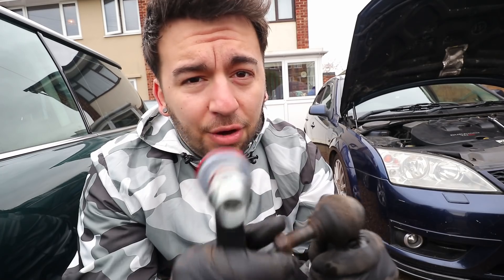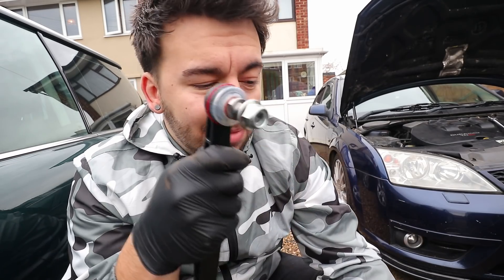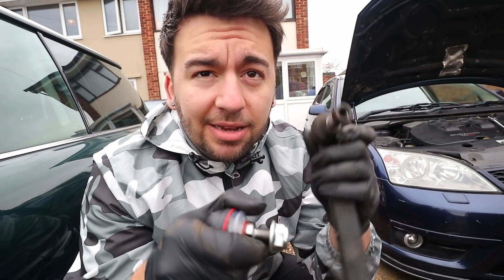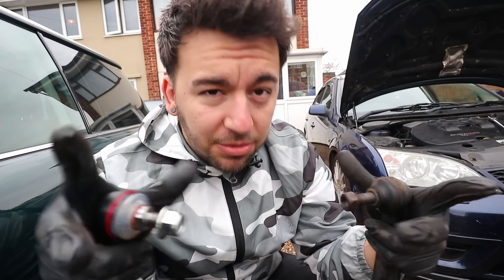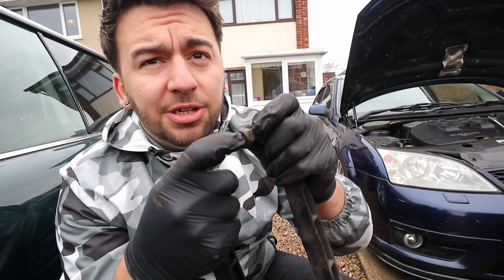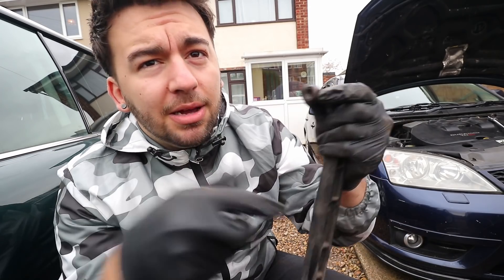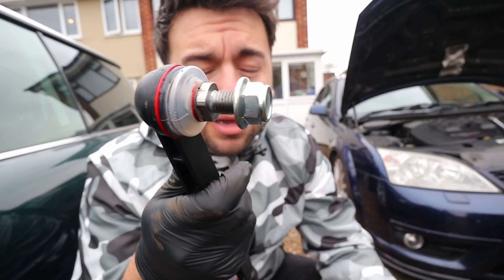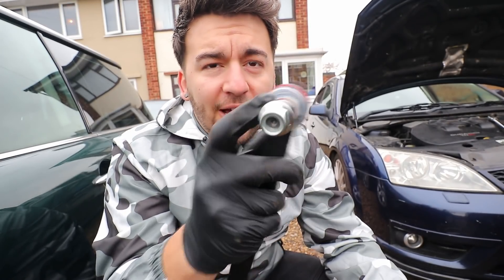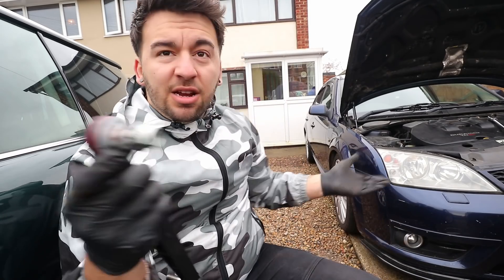The hex ones can round off. The allen key hole actually started to round off a little bit on the top one — very common. When they rust, the allen key bolt hole becomes soft and corrodes away, and the allen keys never really fit in there properly. You just have to be really careful when taking it off that you don't damage it. I much prefer the flat type — they just prove to be so much easier when installing and removing. It's a much better design. So if you can, get yourself some with the flat — they'll be a lot easier to take off in the future and you won't have to worry about messing around with these hex things.